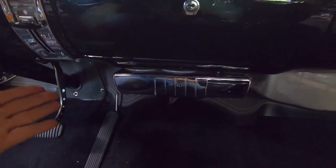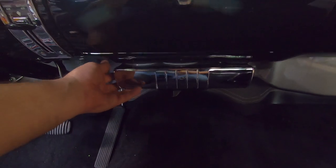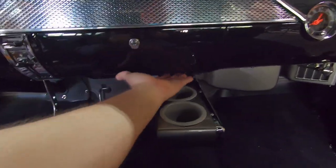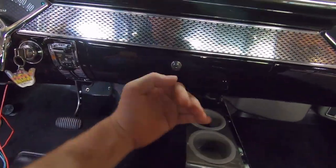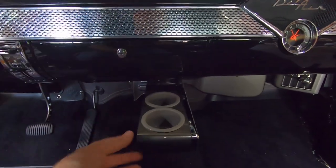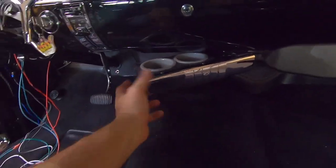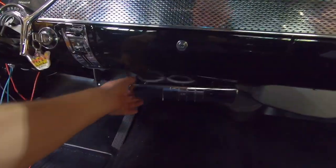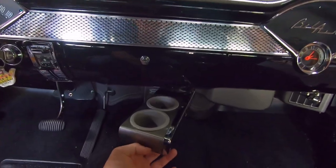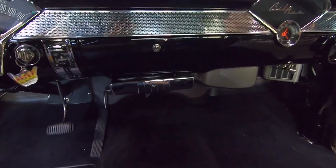This is a Kleenex dispenser reproduction — this was an option you could get in 55. I basically built my own mounts and welded them into the dash. Originally these would be at an angle so if you put cup holders in it you'd spill your drink, so I leveled it in the back and in the slot in the top where the Kleenex goes through. I hole-sawed it and put in these little shallow cup holders I got off eBay — I went with really shallow ones because I didn't want anything hanging down below it where you could see it. I removed the rivets and used little 6-32 stainless steel Allen button-head screws with nylock nuts.